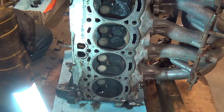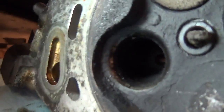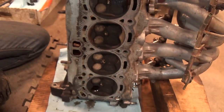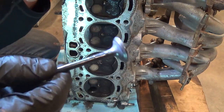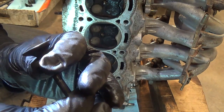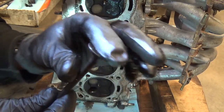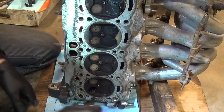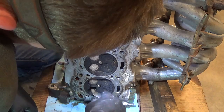And there's what the seat looks like. It's supposed to be nice and shiny all the way around - well, it's not nice and shiny. You can see how it's kind of pitted and we'll get all that junk out of there. I'll lap them in and hopefully take care of the problem for good. Here's what a cleaner valve looks like. I got the stem cleaned up and the head as much as possible. No big deposits. I also went ahead and scraped the carbon off of the combustion chamber here, out of the inside of the seat.